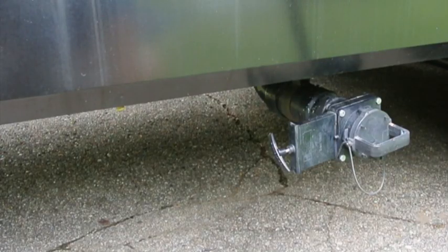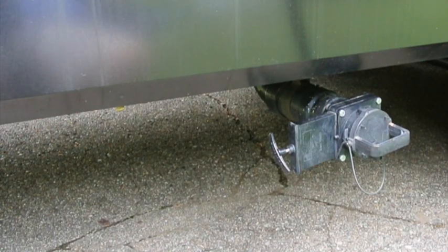I also installed a bayonet mounting valve on the end of the sewer hose fitting, because the design of the trailer is such that we have about 8 feet of nearly level plumbing on the inside going between all the tanks. It takes a long time for that to drain out, and then even when you drain it, you go down the road, and the trailer goes back and forth a little bit. Anything that's left will go down to the end of the drain, and then the next time you open this, you'll get a shower, and you don't want that kind of a shower. With the valve on the end here, this just prevents that from happening.